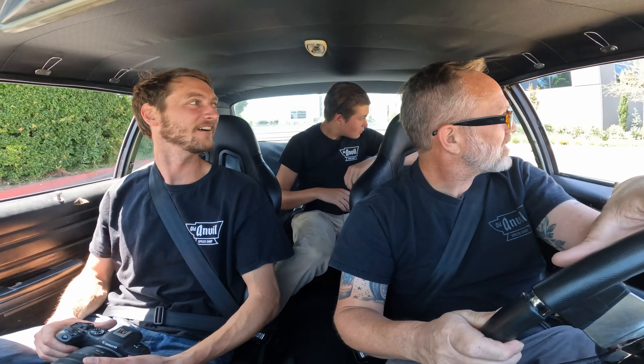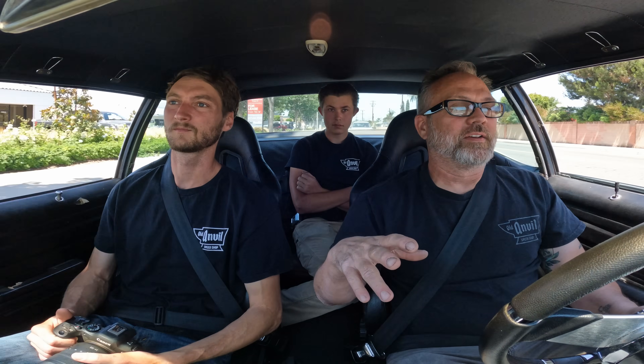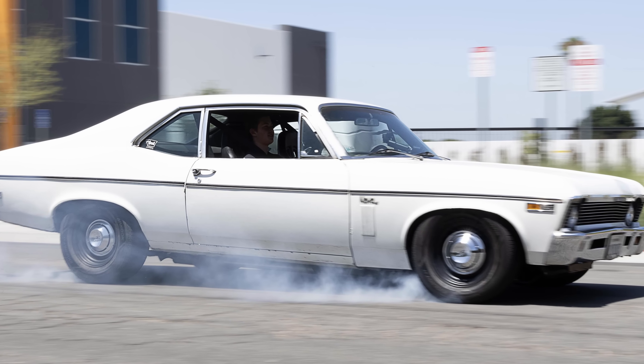We just learned quite a bit trying to get a photo of the back wheels locking up before the front. We found that since we got it tuned pretty close, that is super hard to do. We changed drivers so Taylor could photograph it — and in doing that we took 150 pounds out of the back seat, which changed up the bias a little bit. I tried stabbing it hard and was locking all four of them up — not at first, but eventually about three-quarters to halfway from stopping, it locked all four, which we caught in the photograph.